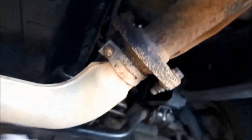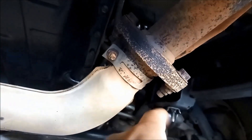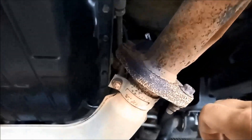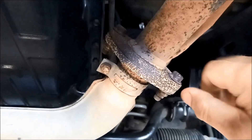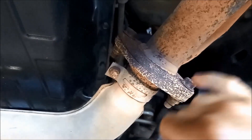When you're taking some exhaust bolts off — the rusty ones — it's a good idea to give them a soak in WD-40, CRC, or something like that. Even diesel is alright sometimes. Don't just try and undo them with a rattle gun or you'll snap it off. You've got to actually work them off sometimes, otherwise you'll possibly break the bolt and create a bigger job. The ones up on the exhaust manifold, you've got to be very slow and patient when you're getting those off.